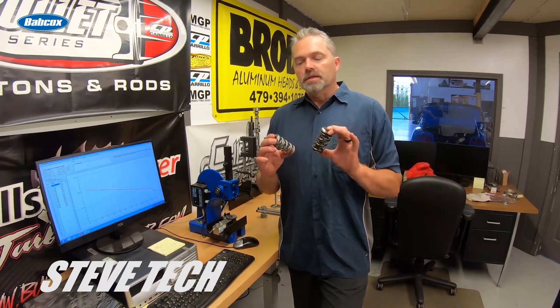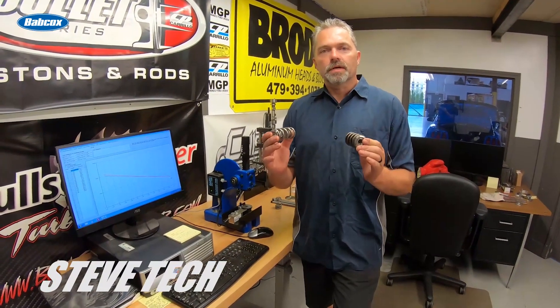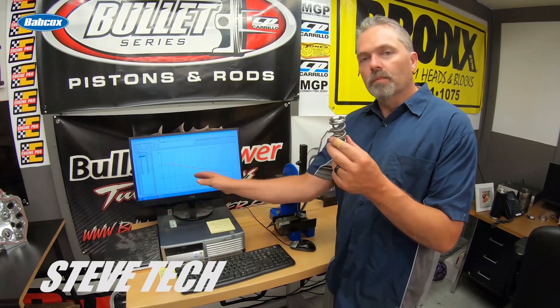The red one has just a little bit more open pressure and a little bit less pressure at closed. What you're finding out here is that we can generate the same pressure, the same curve. This isn't the most technical explanation — there are engineers who figure all this out — but I'm trying to give you good practical information. It all boils down to: this big heavy-duty triple spring and this smaller dual spring do nearly the exact same thing, but the dual spring is the superior spring.